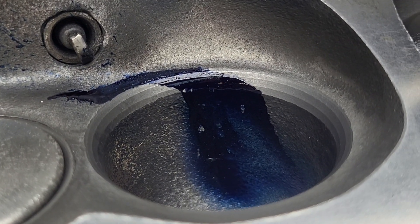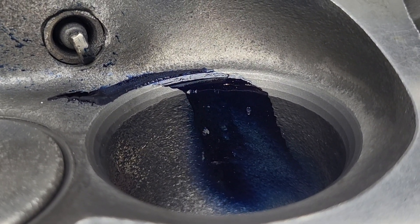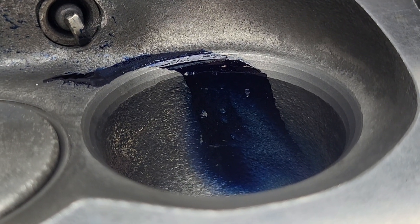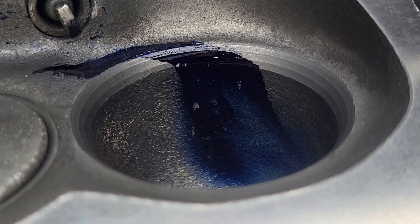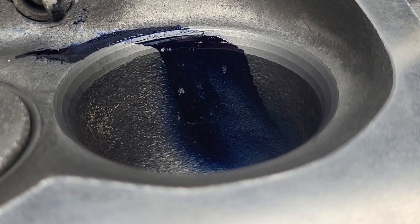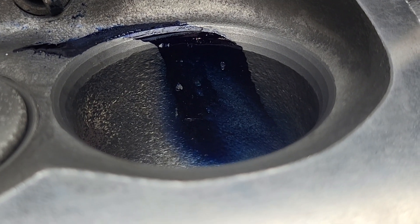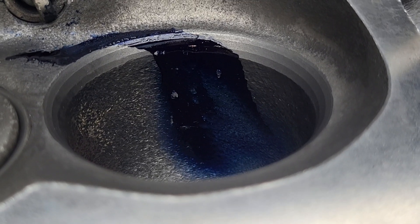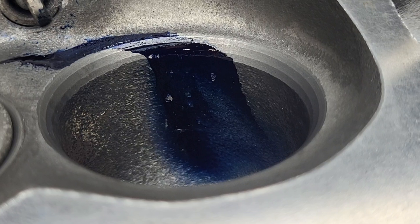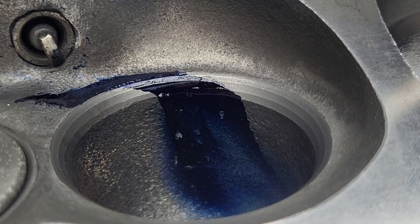The part I'm not thrilled with — and I told the customer — is when I was equalizing the bowls I use my Sioux pilots to measure bowl width on either side and try to get them as close to identical as possible. These weren't blown out, so there was plenty of iron to even them up. The thinnest bowl is still about 0.178 thick, and a lot of spots are still a quarter inch thick. Remember, it's still a 194 — that's the stock Dart valve job.